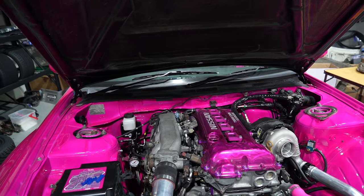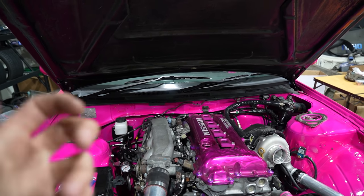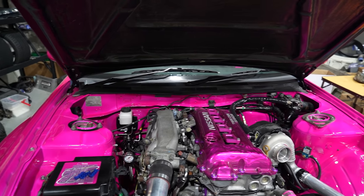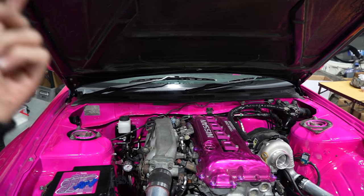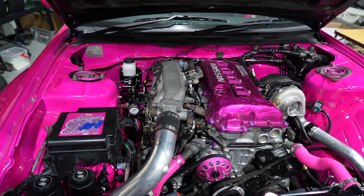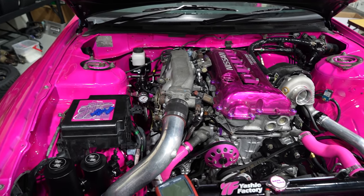So in the Link ECU, if you require a ground trigger that doesn't get grounded when the car is shut off, then what you need to do is make sure you use either ignition or injector auxiliary outputs. So yeah, I can get that finished and wired in now and we'll be good.